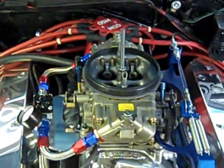So what I did, we run a special bushing, and you can get these bushings, I show a picture of it here, from a place called FOB, and there's a phone number, 541-942-5920. Then you can see the bushing here, that's the MSD 18 degree bushing for 18 total degrees, and this bushing here is for 10 degrees total. And the one I use was for 14 degrees. They make two different bushings. At 10 degrees, you'll have to file a little bit on the edges. They'll tell you in the instructions because it won't fit in the slot. So you just file both sides and it'll go in there.